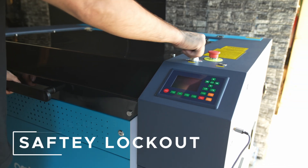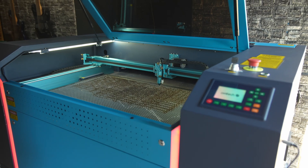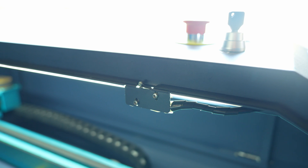Issue three is a safety lockout. If your screen says 'machine protected,' it means a door sensor isn't registered or closed. The Pronto has two sensors per door, so be sure both the front and top doors are fully closed and check sensor wiring if needed.